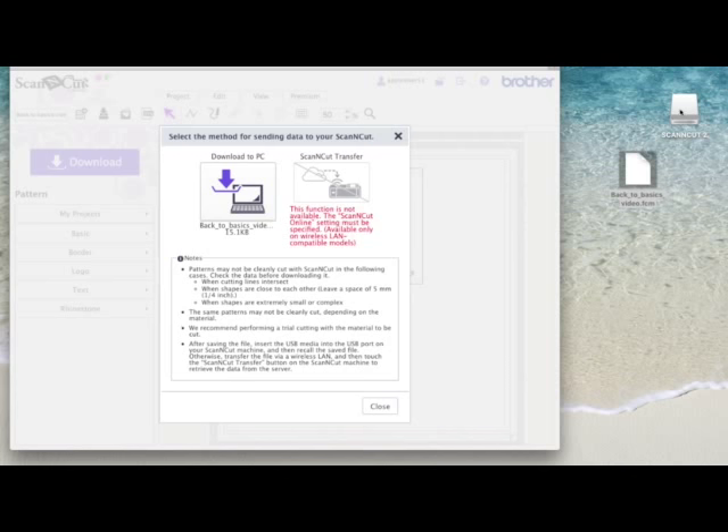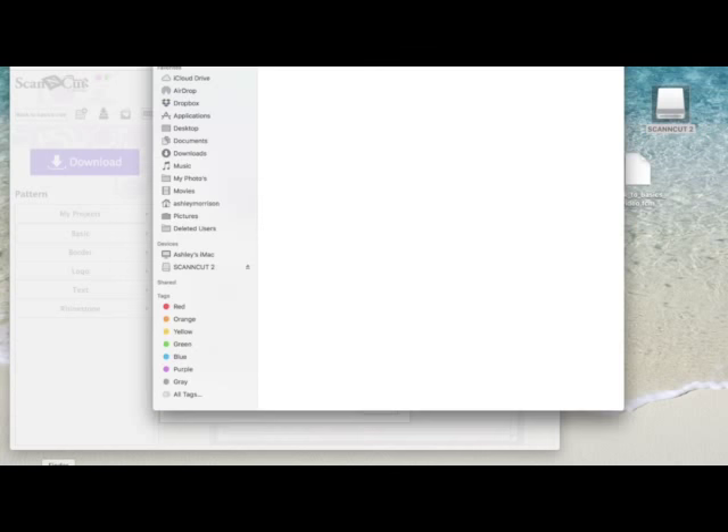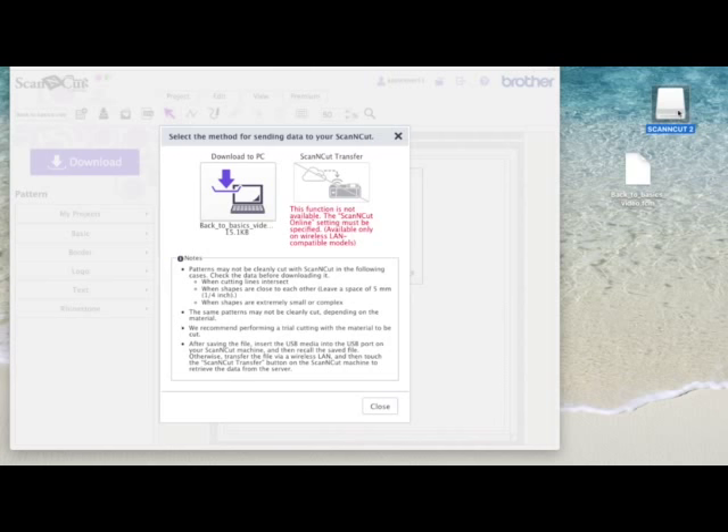The next thing is to take the USB stick out of your machine. You must never just pull it out — you have to eject it properly. On a Mac, click the little triangle-and-rectangle eject icon next to the USB stick, or right click on the USB stick on your desktop and choose Eject. Once the USB stick disappears from the desktop — sometimes you'll get a message saying 'safe to eject' depending on your system — you can then unplug it and take it to the machine.